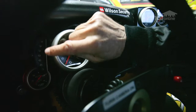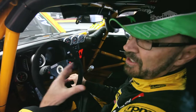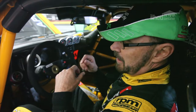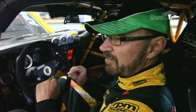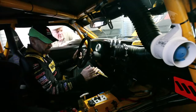Except that I've got shift lights in it. You set them so they progress from the bottom up, so that you know when to change gears without looking at the tacho. This weekend with this car, I'm allowed to use 7,100 RPM. There are other cars that can use 7,700, some 7,400 — it varies from car to car. I won the round in Adelaide, so I attracted a 300 RPM penalty. So we set the lights so the last light comes on at 7,000 revs, and then you change gears — you don't have to take your eyes off the road and look at a tacho. It's just easier.